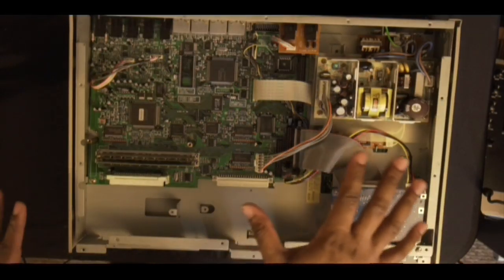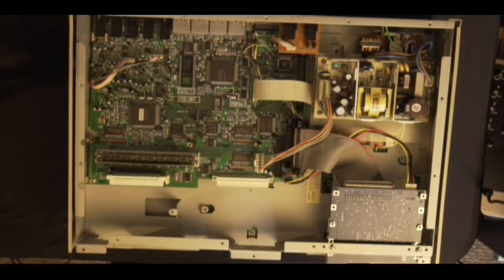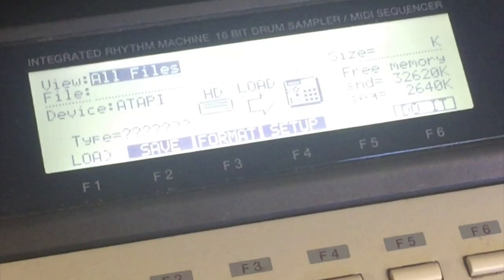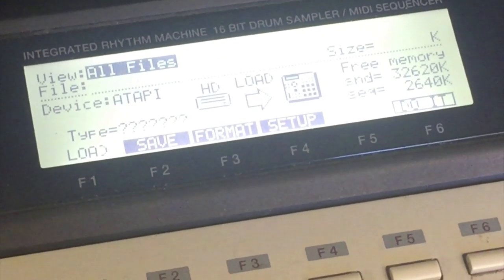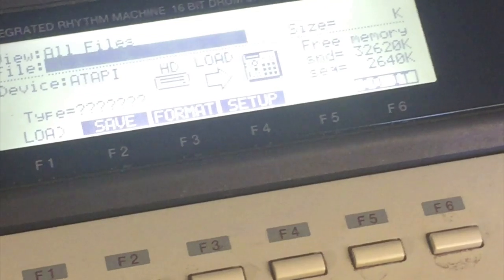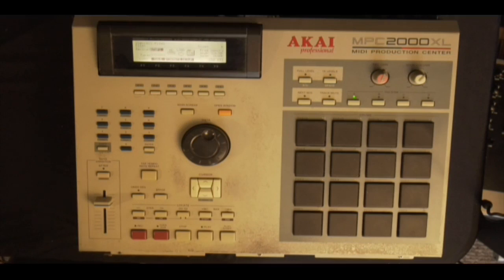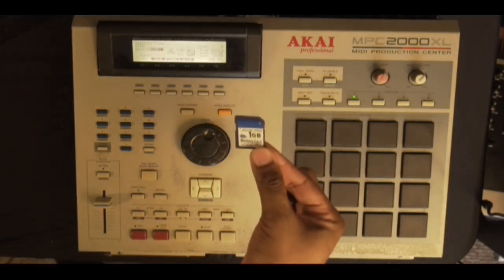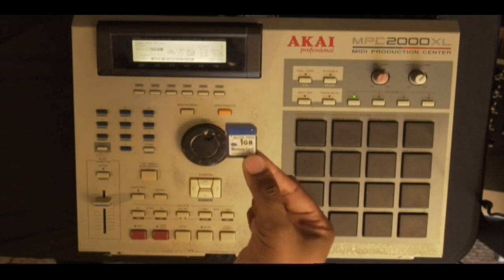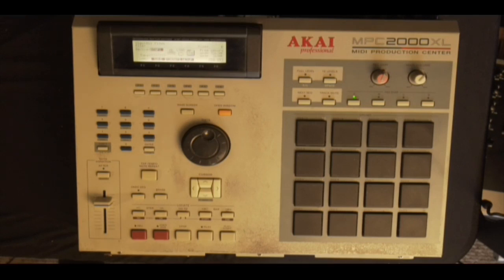Now, without putting everything back together, like all the covers and the back end and all that stuff, turn it on and make sure it works. Okay, this is how you know if it's working. Under device, instead of floppy, it should say ATAPI. Right there, see that? That means it's been replaced. Now I should be able to use SD cards, and I'm gonna show you the SD card that works. This brand right here definitely works. These are 1 gigabyte SD cards, Elite Pro. I'll leave a link below for these. And we should be good to go, so we can put everything else back together.